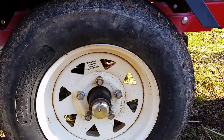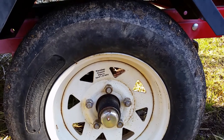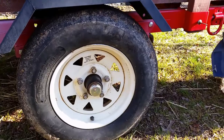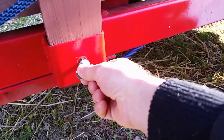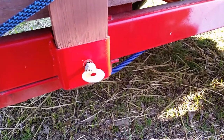These are not radial tires. One commenter mentioned he replaced his with radials and the trailer runs a whole lot better — something to consider. These little washers I welded onto the bolts so you can get them out are holding pretty well; none of them have broken off yet, which is a good sign.